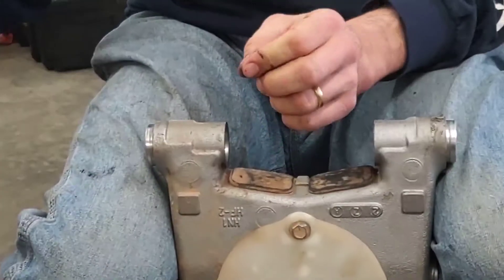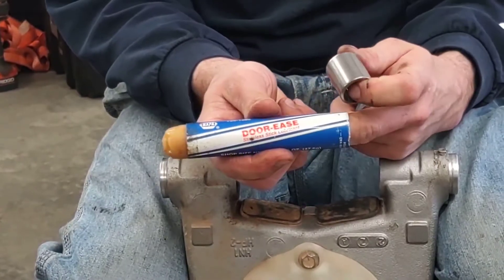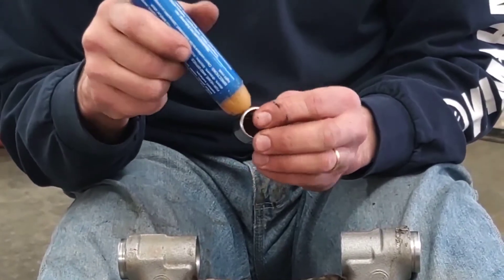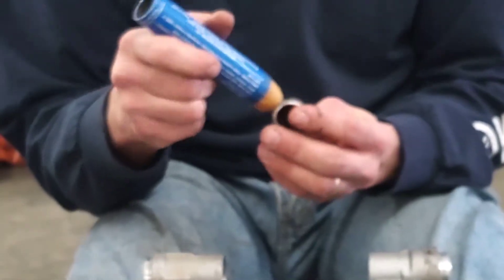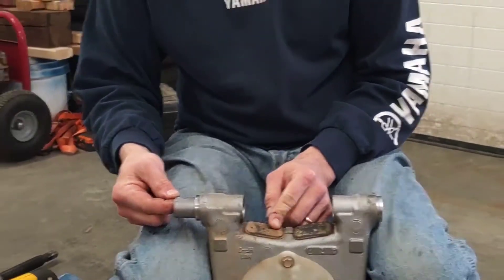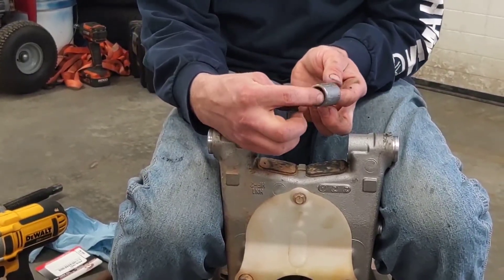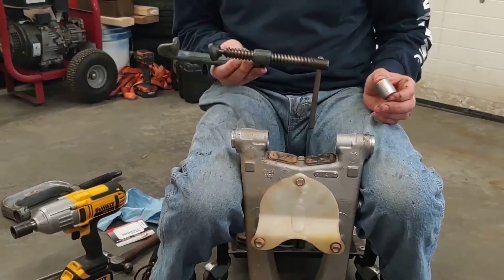So here's our new bearing. To help this bearing slide nicely into the swing arm we're going to lubricate it. If I've never shown you this stuff before, this is basically just a wax stick that you can use to lubricate things — it's really good for pressing bearings. So I'm going to use this like a crayon and color some wax on here. So we need to press this inside the swing arm like so. If I was to hit this with a hammer, I would damage the outside edge — that's a hardened steel outer race, they call that a drawn cup. If I hit this with the hammer I'm going to dent it, it's not going to go in properly. It should press in fairly smoothly, so I shouldn't need anything more than this C-clamp. If I do, I still have a ball joint press here for a little extra force.